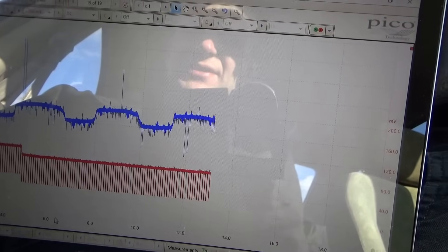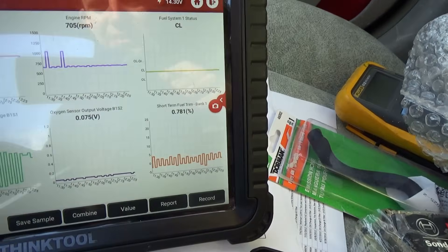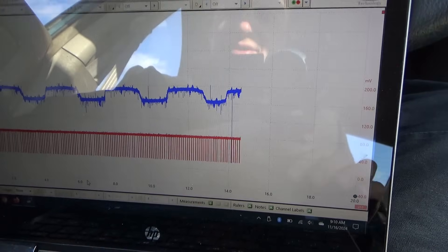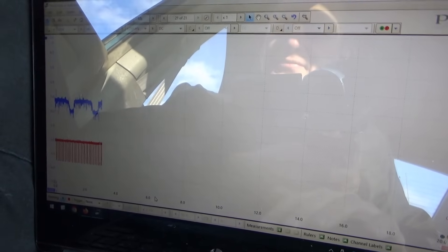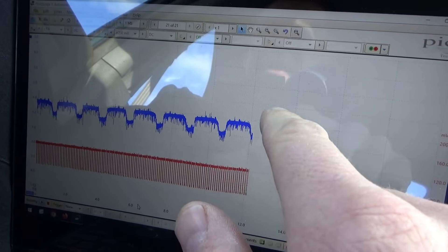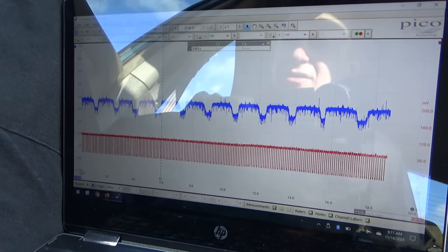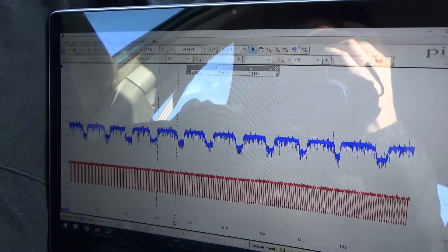Do we trust the sensor even though it looks fine? Maybe the computer has to mess with the fuel trim a little too much — you can see it goes from 0.7 to 3%. It has to wait too long for the sensor to change. I expect to see a nice even sine wave but it's stuck high, then boom, boom, stuck high again. You can measure how long it is in the high range — 1.1 seconds. That's not good enough. It's supposed to respond faster than that.